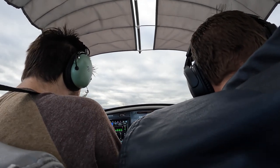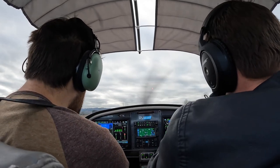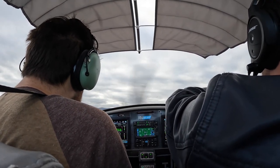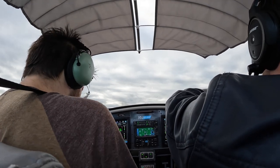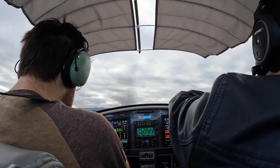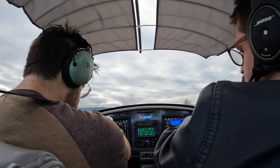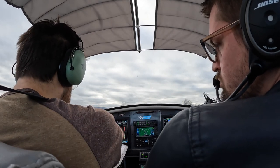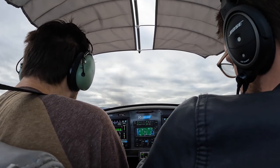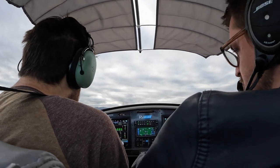Throttle. Going up to 5, back down to 4. And then we'll test lane B. Go to 5. Back down to 4. There's 4, lane B, watch for a drop, and a light, and back on, watch for the light. Okay, lane A, off, we got the light, watch our RPMs, okay, back on, watch for the light. Okay, back down, throttle 2000.